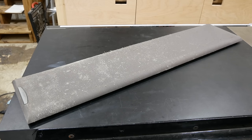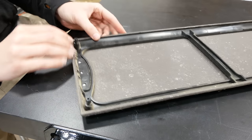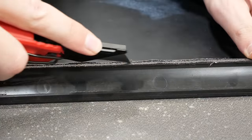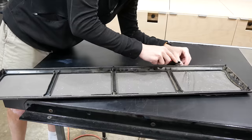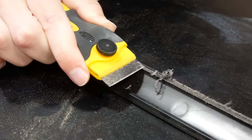While the poly was curing, I turned my attention to the speaker grills — and for as good as the speakers look, these grills look equally terrible. On the front I pried the logo piece off using a plastic pry tool, and then looking at the back of the grill, the cloth had been heat pressed and fused to the frame. To remove the cloth I scored it at the outside edge of the fused section, following the natural groove that existed there, and continued around the grill until the entire cloth was free, then used a scraper to remove any old cloth remaining.